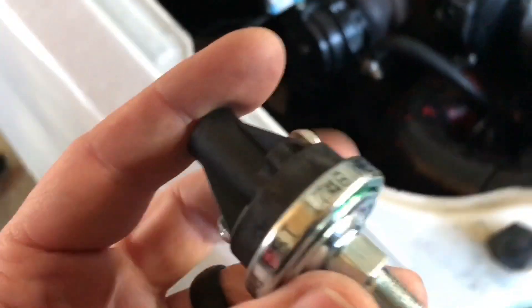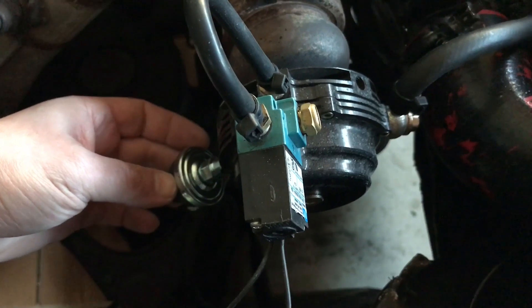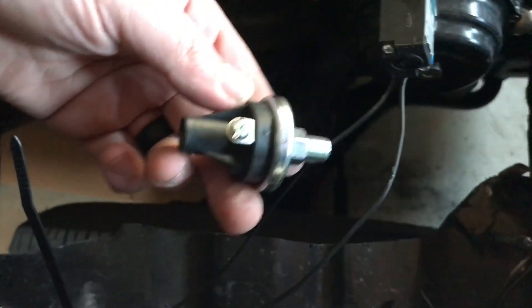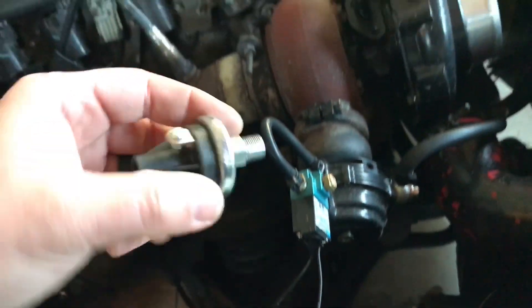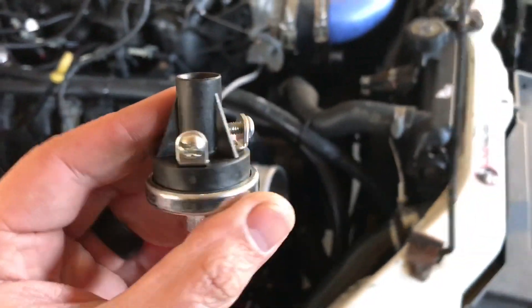What I would like to do is the same thing. That's not big enough — that's the water cooling thing. But there's one more plug on the back. I can take the plug out, and this is 1/8-inch, and this is 1/8-inch, and this is 1/8-inch. So I'm going to daisy chain the block again and put this guy down here, and put everything on the lower diaphragm ports on the wastegate. Then cut the line here and connect it in with the little hoop connectors. So be right back.